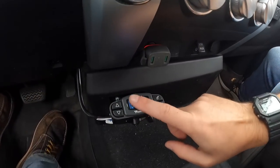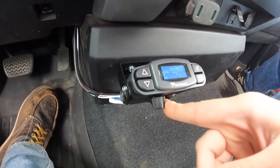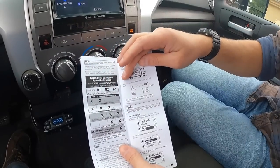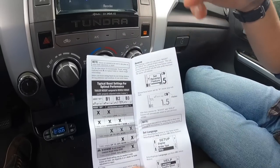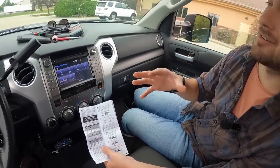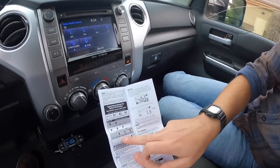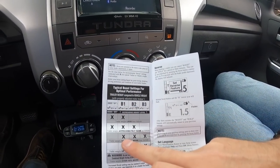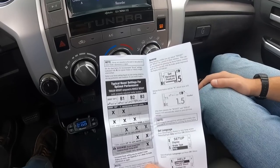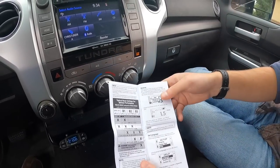Right now we can see on the controller: Trailer 1, profile, boost level 1. I can turn that all the way up to full pressure on those brakes. There are a couple different boost settings — no boost, or boost levels for proportional braking. The truck's curb weight is right around 4,900 to 5,600 pounds, and the trailer right now is about 6,000 pounds, so we'll probably start on boost 2. When it's unloaded, boost 1 or 2 is probably all we'll ever need. We'll try it out and see how it feels.